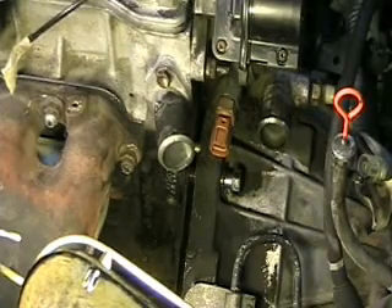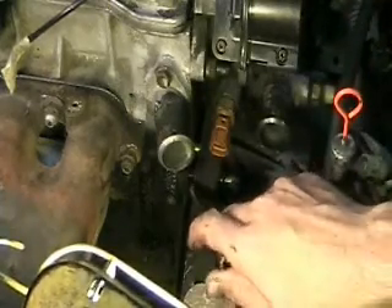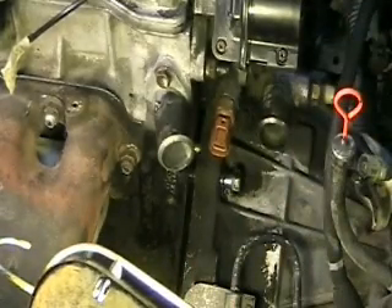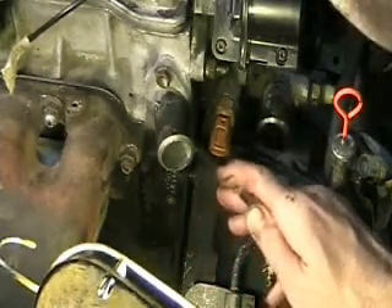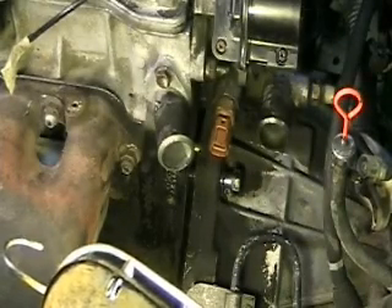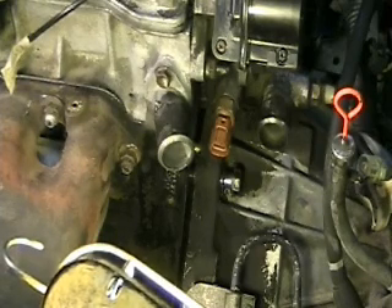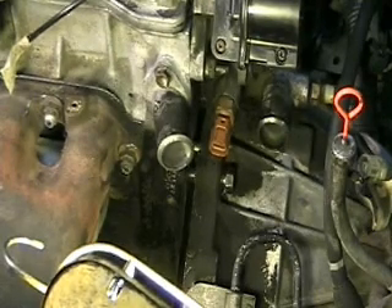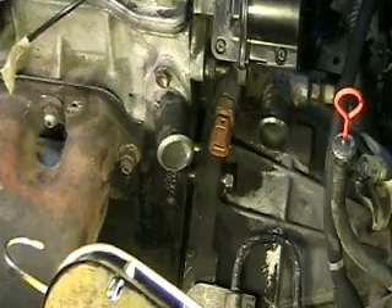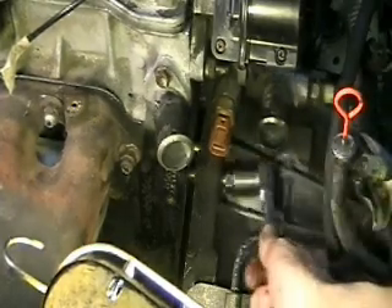We are just about there. I know that because I've already got a bolt threaded in. Remember, I'm not threading it in to pull the engine and transmission together, because if my flywheel is not all the way in the bell housing and I do that, I'm going to bend and break the flywheel. Right up here I can see one of those alignment dowels, and that is actually in the hole. There's another one back here that I can see is also in the hole. I've threaded in a second engine-to-transmission bolt, so I know the transmission is lined up. It's taken me a good 10 minutes or more to get to this point — it's very difficult, so take your time and ask for help.